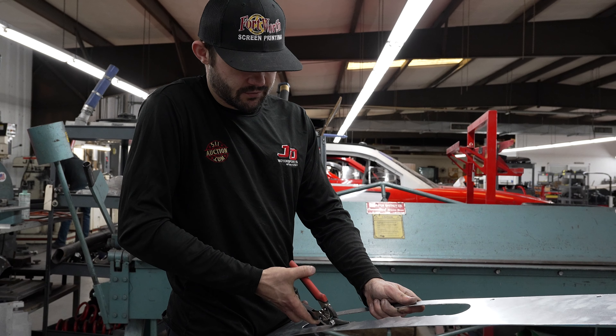Now we need to - like how this one has kind of stepped like this - this part of the body will actually step down and go down to this surface, and then the plastic part of the skirt will lay on top. After these three holes, we'll put some rivets right there. We'll go ahead and mark where the bead roll needs to be. Because I always mess this up, I'll get my plastic skirt, lay it right there where it should stop, and then I'll try to get the top all lined up and mark it straight down so the bead roller will line up with the other skirt.